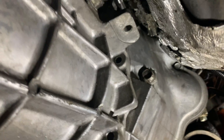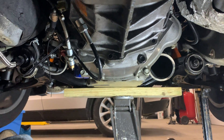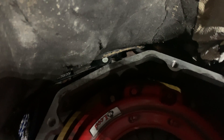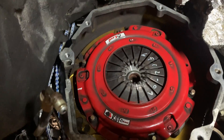I'm going to show you the good, the bad, and the ugly about having an LS swap BMW. Getting the transmission out is a pain in the butt. I'm going to try to do the transmission first and maybe get access to the bell housing — I got the top bolt there with a long extension. I also unbolted the subframe about a half inch to lower it and loosened the motor mounts a little to lean it back. That top bell housing bolt is right there with a socket ratchet attached — I literally had to use a rope to pull it down to loosen that bolt.